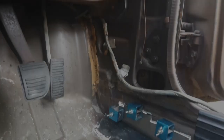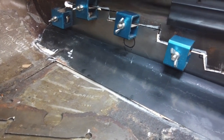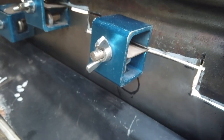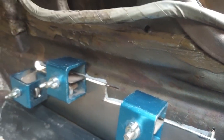I've jigsawed the metal, I've got the clamps in position, and just mocking it up with that floor piece - you can see it's pretty much there. We've just got to close the gap up a little bit on that last one, but that is it. The butt clamps give you that couple of mil to infill with weld.